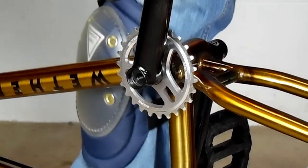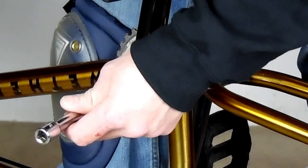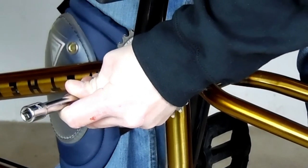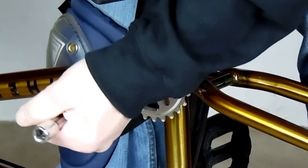After that, we need to punch out the spindle. If you don't have a crank arm remover/setter tool, I usually use an extension with a socket — I think I have an 11-millimeter on here. It works really well on the 19-millimeter spindle. I put my knees with my knee pads against the frame so that as I'm hammering on the extension, there's no chance I'll accidentally bend the frame, as opposed to having it laying on a workbench.